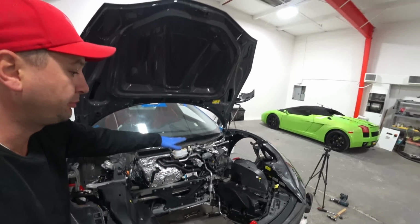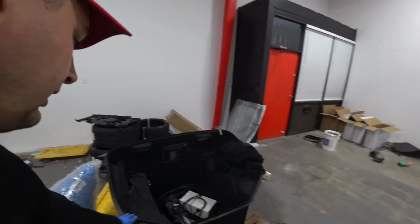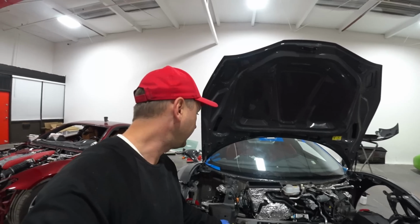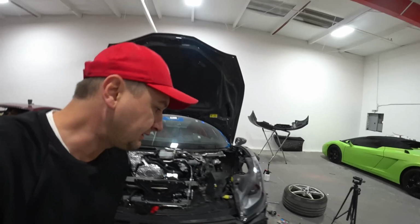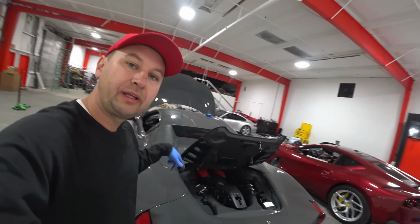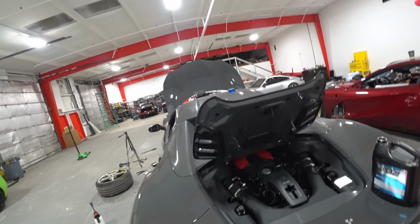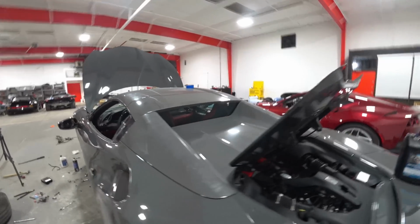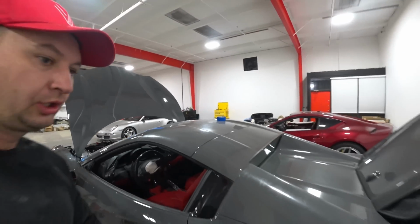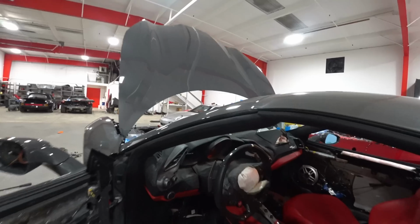After that I have to put in the trunk cover. It's over here, that one. This trunk cover is going on after. Right now I put in the antifreeze, and I'm gonna start and bleed the radiator system. Okay, I just put in some antifreeze, and I'm gonna start the car and add more, because when the car is running, the whole system is bleeding, you know.